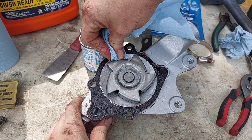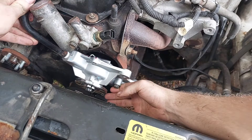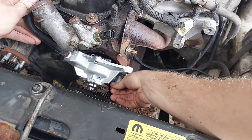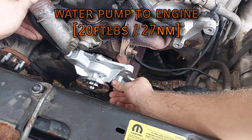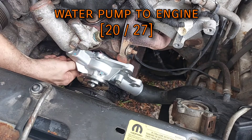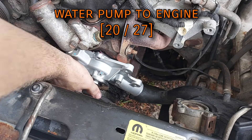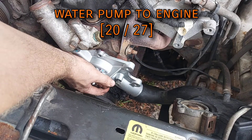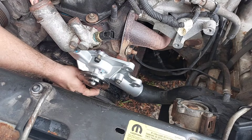With both sides of the gasket painted, lower the water pump into place with a bolt ready to go in. Once lined up, tighten all four bolts in an alternating pattern to only 20 foot-pounds — honestly not that much. I like to go to 25 just to be extra sure, but 17 to 20 is what the factory service manual says. Check the description for a discount link on one from eManual Online.